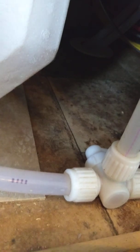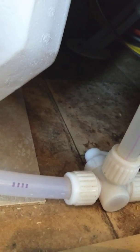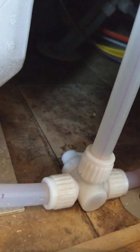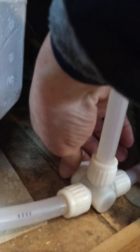So, right now there's a valve right here, and the valve is parallel with this line that goes into the water heater. That means the water heater is in camping mode because it's been dewinterized by us. So, basically, you're ready to camp. In the fall, when you pump antifreeze in or have it done, but I'm sure eventually you'll do it yourself, most people do, it's very simple to learn, you'll change the position of this valve up like this.